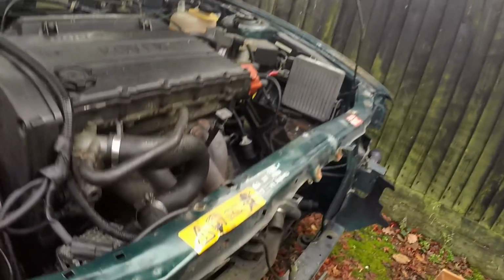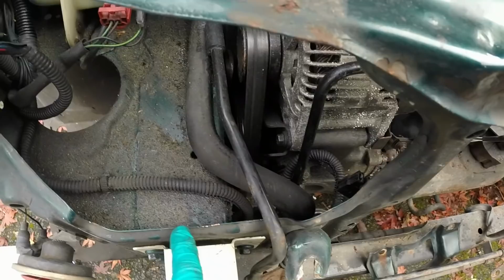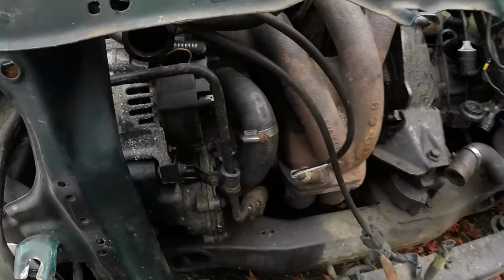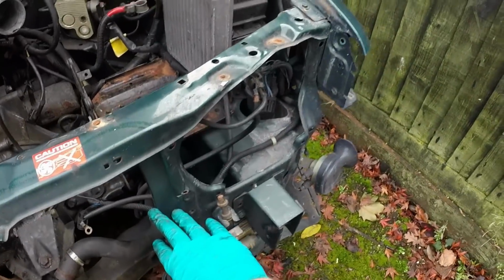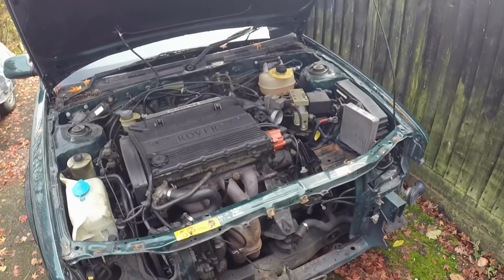That's quite good. So that's come out straight-ish. That obviously needs to be tapped down ever so slightly, but remember this is quite a crude pressing, it's just stamped out, so that needs to go back in. Then I can work out how to get that out if I really care, that is. Remember, regardless of what I do with that bit, this bit and this bit are going to stay, because I don't want to have to drill out all of the spot welds across the whole of the front. So I'll go and get the white bit and then continue poking.